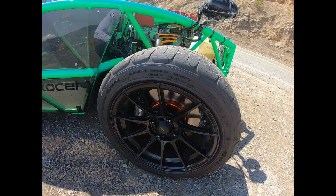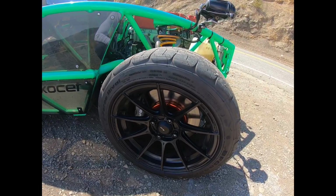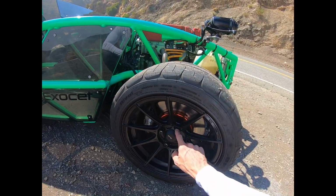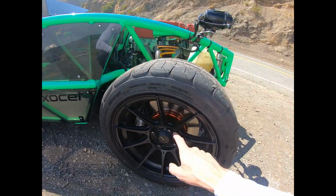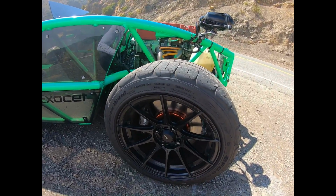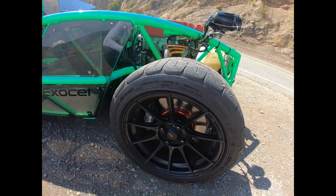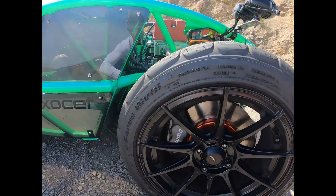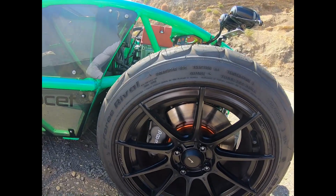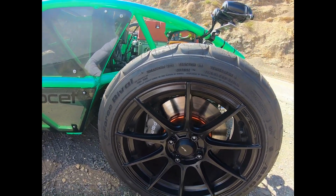I haven't had good luck with wheel spacers before; they introduced vibration when they had their own studs. But these are the actual studs that come through, the elongated ARP studs, this 1-inch spacer, and no vibration. And I've had it at the track, it's fantastic. Speaking of brake clearance, another thing that's fantastic is this is the 11-inch box mount kit from Super Miata. Fantastic brakes. I cannot recommend these enough.